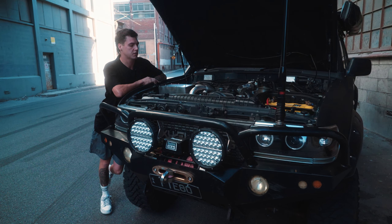The paint is all Raptor paint — I sprayed it at 90 PSI. With the paint, if you crank the PSI up it comes out a little bit finer, more like this. If you drop the PSI down it's almost like a coarser grit sandpaper finish. There's a lot of debate on why I went with Raptor, and the main reason was that a previous owner used acrylic paint — a respray was going to cost something stupid like 12 or 14 grand. So I did this all myself.